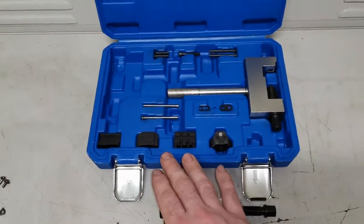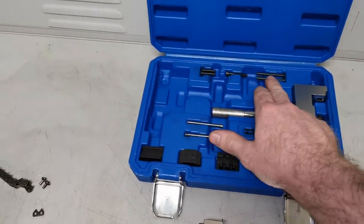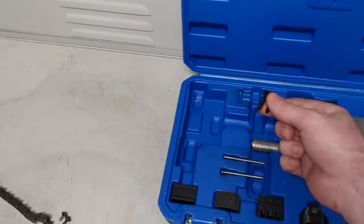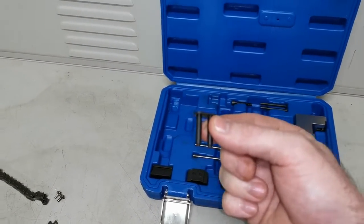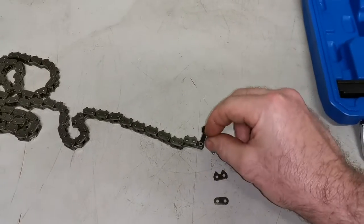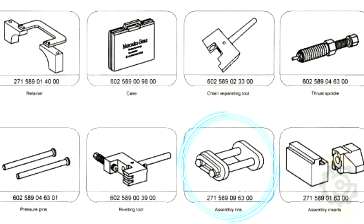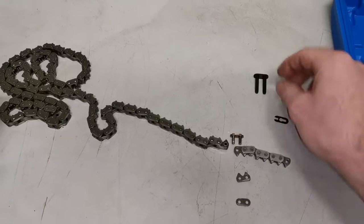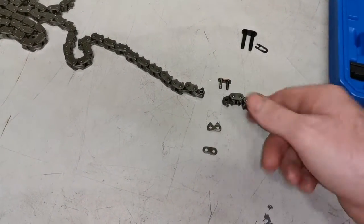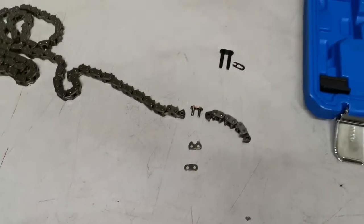This is the smaller piece kit. There is a larger piece kit linked in the description which has more pieces — I think six or seven — plus more connection links. The most noticeable difference is this little linking piece. When you delink the chain, this is the item you use to relink. It's meant to be very simple, fast and effective — you put it through and connect the old chain to the new chain. You simply put a cap across the top and the chain stays in position, but it didn't fit for my application. What I did instead was reuse one of the links I disconnected to connect the old chain to the new, which added some time but allowed me to bypass that problem.